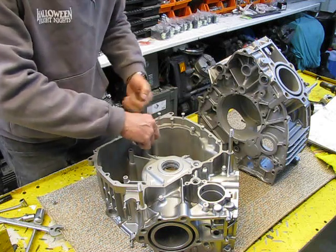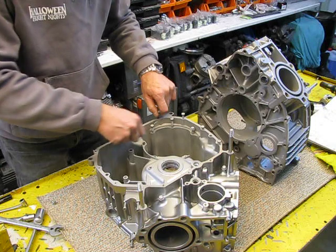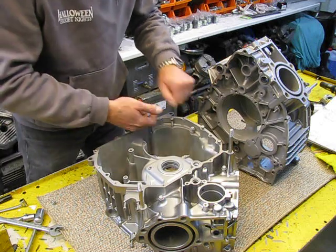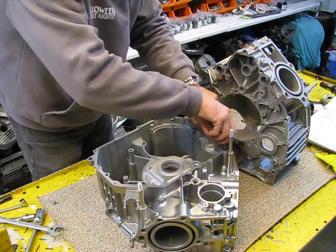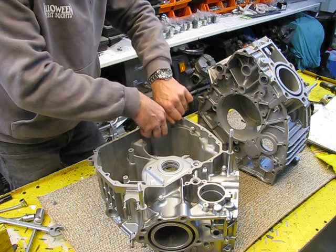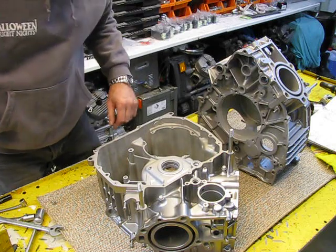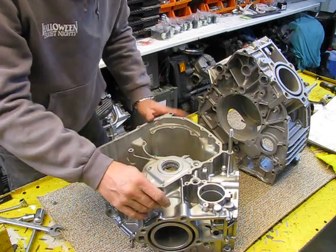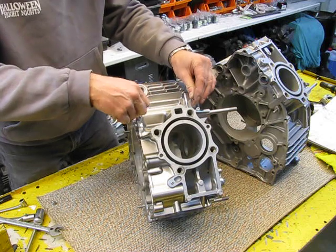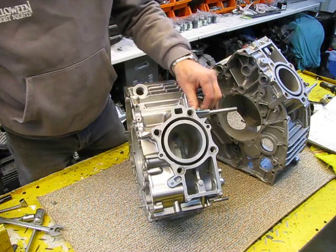For the first 5 to 10 minutes, let the engine run on clean oil, new oil, maybe even used oil of another engine. That's not a problem, but leave it idling, turning, pumping oil inside the engine, and then you get the oil out. So five minutes and you change the oil. Do that 3 times, and every time you do that you check your oil filter. If you find particles, and I can tell you, you will find particles, that's not what you want.